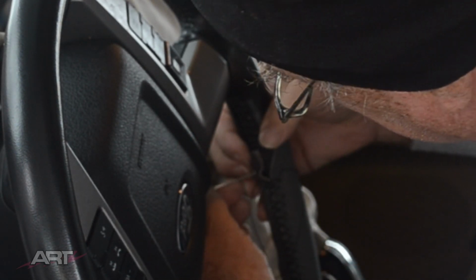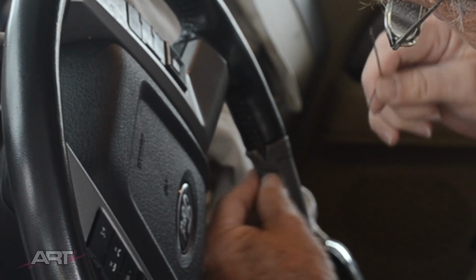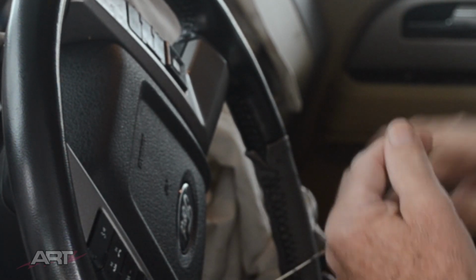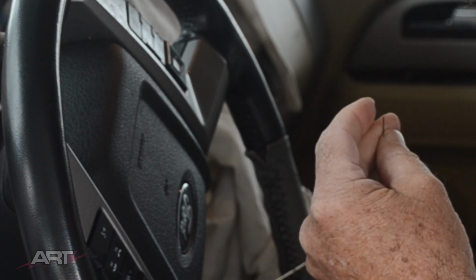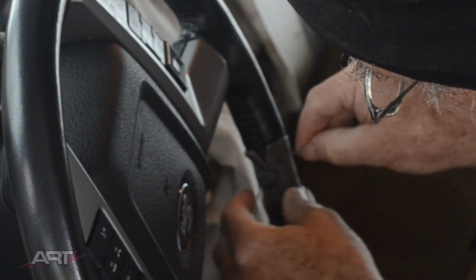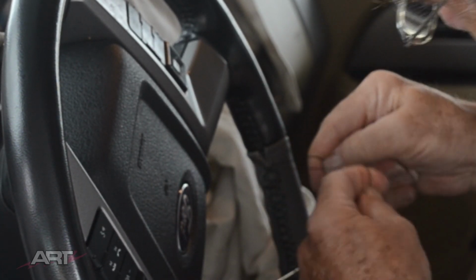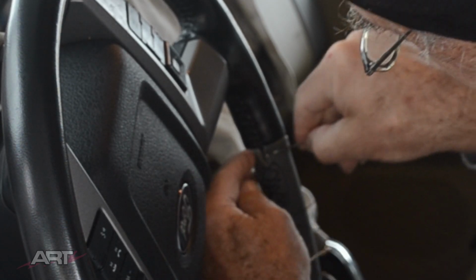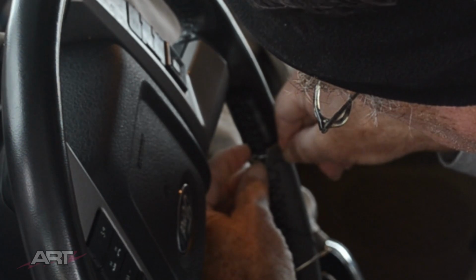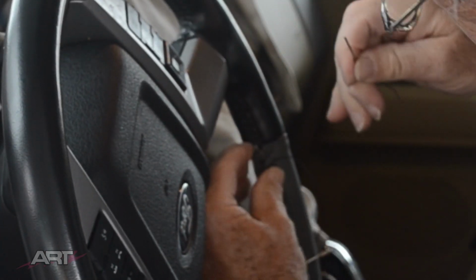So now we can put our needles back on the thread and return like we were doing a minute ago. And the other nice feature about this particular way of stitching is that when you come to the last hole, you're already going straight across from front to back and back to front. So this is the way we always wanted to do on the ends, to square off the ends. Well, we're automatically going to be squaring off the ends by just continuing our normal stitch.